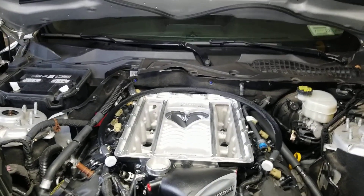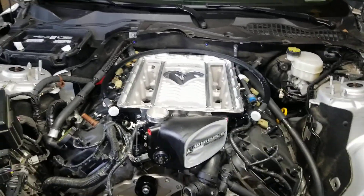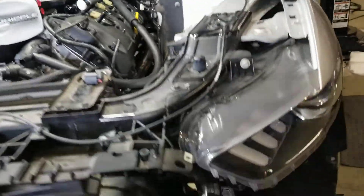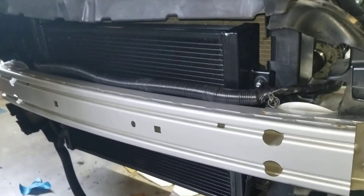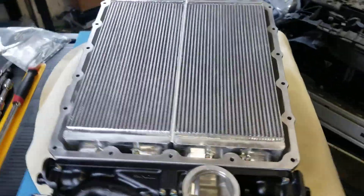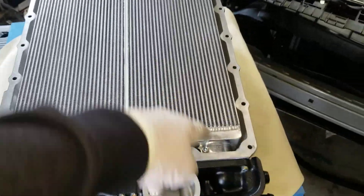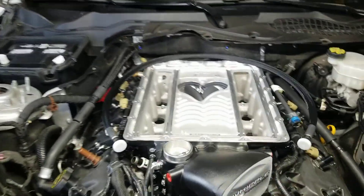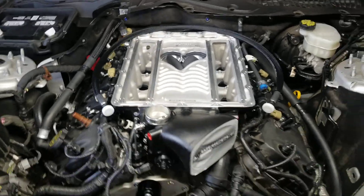Apparently this is one of the best cooling positive displacement blowers out there. It has a tank and a little pump that will circulate coolant through the massive — I have the extended heat exchanger, got the bigger one — then it goes back through here and flows through the lid on both sides. Cooling in, cooling out, cooling in, cooling out in both cores. Otherwise you'd have one bank of cylinders running cooler than the other if coolant just came in one area and out the other.